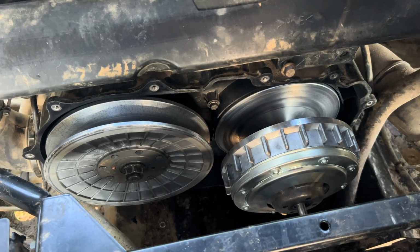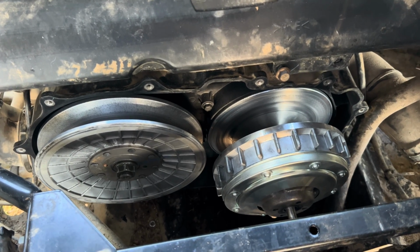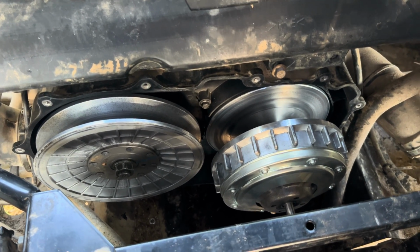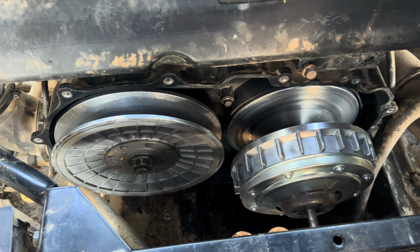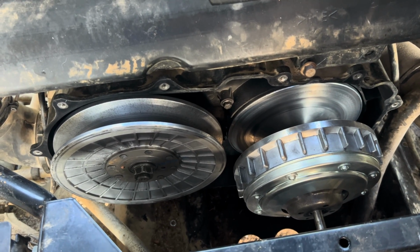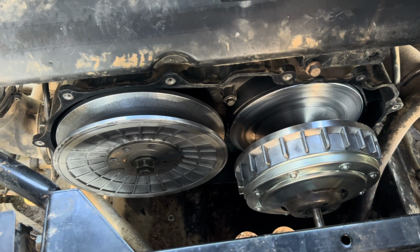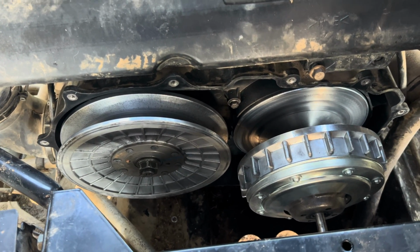So what I've got to do is go back inside the crankcase. I've got a roller bearing that's turned the wrong way. Anyway, one-way roller bearings don't turn one direction. I will show you how and why in a minute. But I've got it backwards, and I'll show you how I made my mistake as well. Maybe it'll save somebody else some hassle.